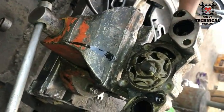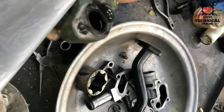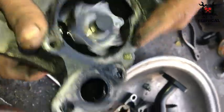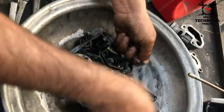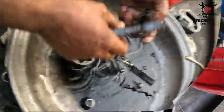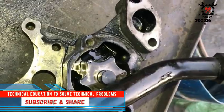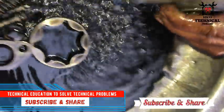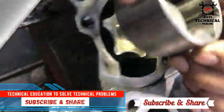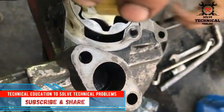These are the gears of the oil pump. You can take out these gears easily. This gear rotates inside the other and the pressure is built. This is the piston — it builds the pressure. On one end of this piston there is a spring which keeps the pressure stable, and the extra pressure is released back into the chamber.